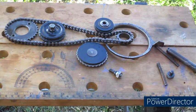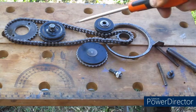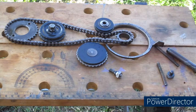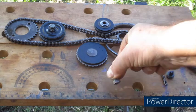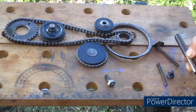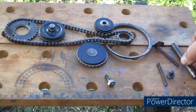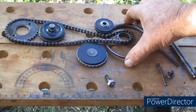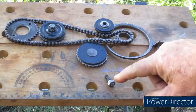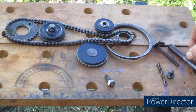When the engine rotates, it rotates anti-clockwise, so this will be the tight side of the chain and this will be the slack side. When we loosen the screw and lock nut, that allows this plunger to be free to move. With the springs behind it, it moves this adjuster — it all rotates and tensions the chain. We then lock off the adjuster, and that locks the adjustment in position.